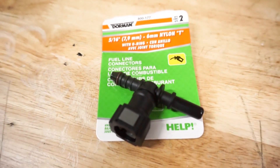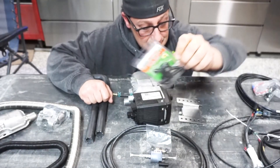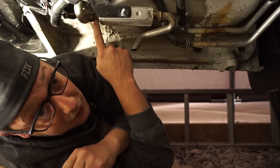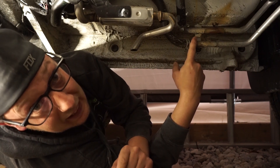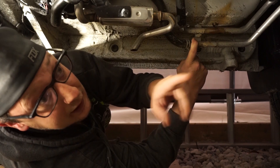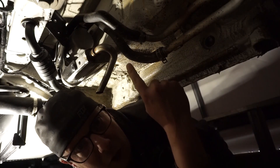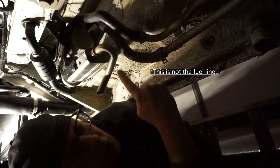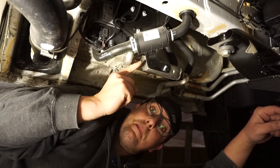This T-fitting does not actually come with the kit because our van Romer already came with a unit installed for engine preheating — it does the same task as our heater unit but it's for preheating the engine on very cold days. You don't want to start a diesel engine when it's like minus 30. Mercedes only gives us one spare auxiliary fuel line out of the tank, which is already hooked into that preheater.